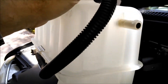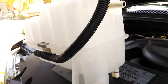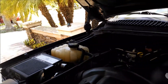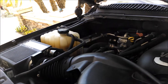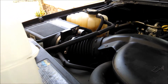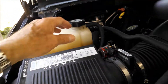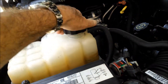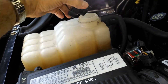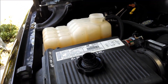I'm going to show you how to put this new tank on. Before we start, make sure the engine is cool. I just started this up for like a minute to pull it into my work area. Make sure that this overflow tank is not pressurized — mine is not pressurized because I just ran it for a second or two. There's really only two nuts, one there and one there, two hoses — the suction and the return.